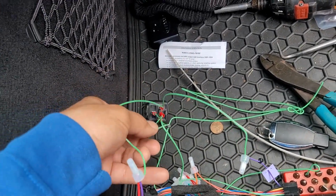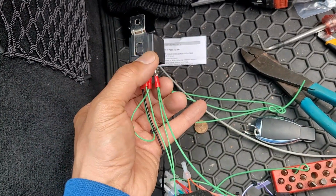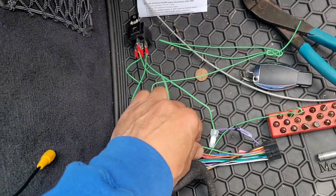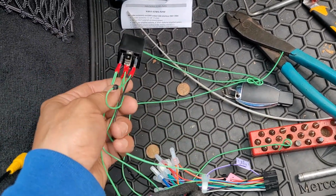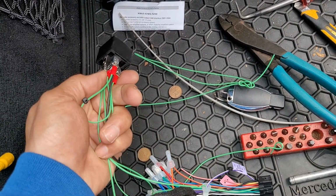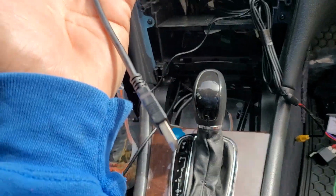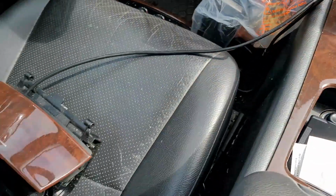That's my reverse wire. And we got ground, because this is a positive. So here's my trigger, here's my ground. And we're going to give the other light green, which goes to the e-brake. So when it hits reverse, this guy opens up and then closes when he's out of reverse. And that's how you bypass the Pioneer. So let's continue on. USB, check. That I ran. Follow. Right into this guy.